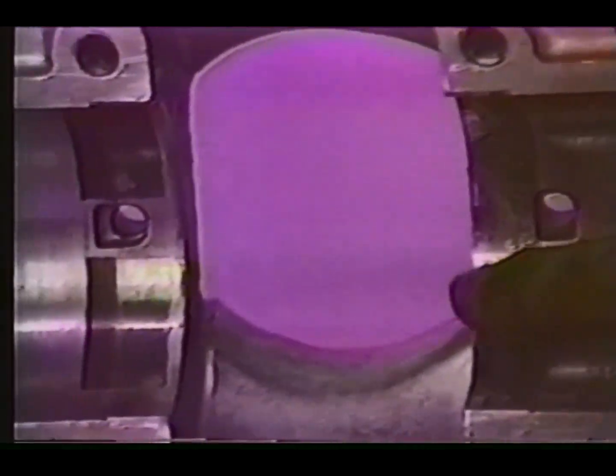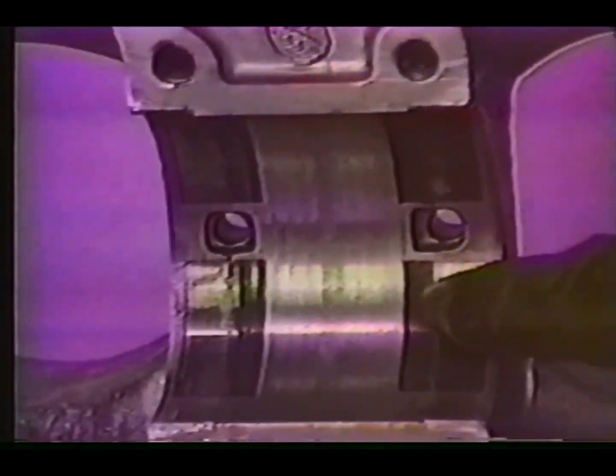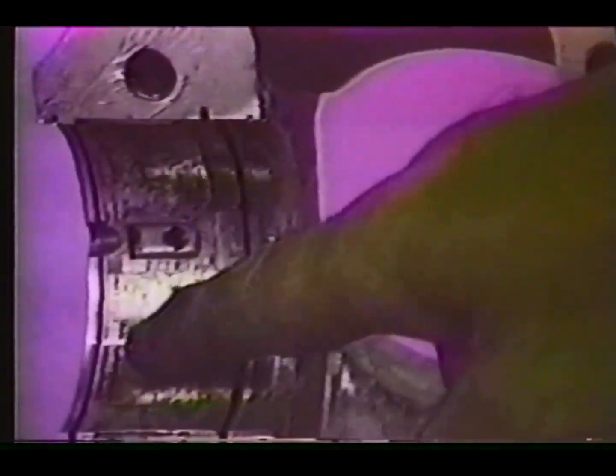Next, make sure the crankcase is in good shape before reassembly. This is done by inspecting the bearing journals in the case. Some crankcases have steel inserts around the exterior of the bearing. Some are just aluminum. This shows a crankcase that the bearing has been chattering in, possibly because the crankshaft was crooked. One way to check for a good quality case is to simply insert a bearing into the journal area.